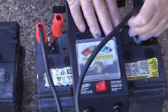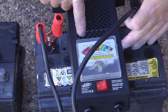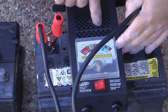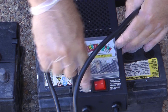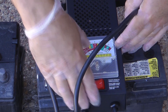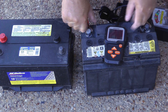It's showing four volts right now — it's got a bunch of dead cells. This particular battery tester I got at Walmart; it's not the Harbor Freight one Chuck was suggesting. This is the load test — it puts a load on the battery — and you can see it drained it already about one full volt. It's so dead it may not even power the tester.